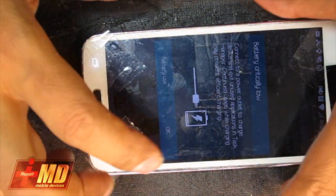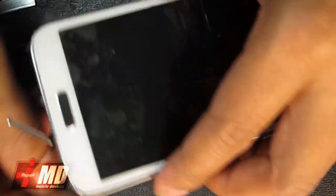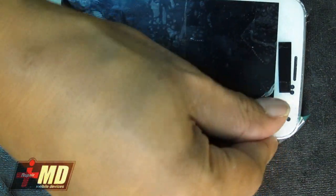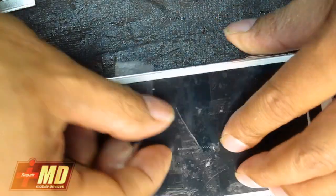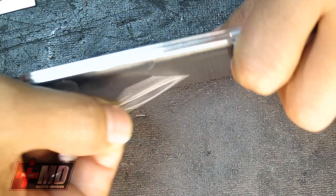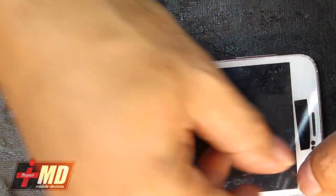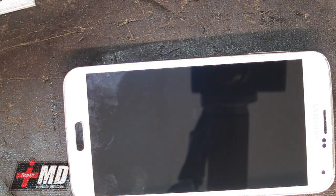At this point the battery is a bit low so I'm going to charge it. It takes about 20 minutes for the glue to set, so I'll be back in 20 minutes to unwrap this and clean it up. Now it's been 20 minutes — go ahead and remove the tape. The 20 minutes allows the STX silicone seal to cure properly. I would still advise your customer to wait a full day before putting it into a case. Now I'll use electronic alcohol to clean the screen up.